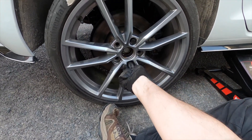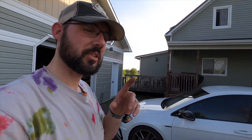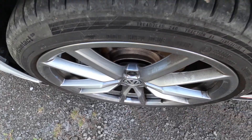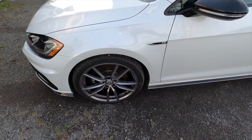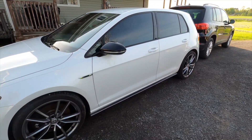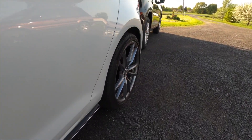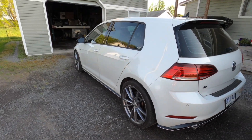The fronts are done. I tend to hold the wheel on with my foot while I get one bolt started, and then let go once it's holding. Things are looking good — I've got the wheels and tires on. I'm torquing the wheel bolts because I'm running brand new wheel bolts with the new spacers. I've already torqued them down to 80-plus, and I'm going to go for a long drive and then torque them again, just because with new hardware and spacers I don't necessarily trust they won't back off. Take a look at the fitment — 10 mil on the front and 17.5 mil on the rear. The wheel gap will come down a bit since the car was just lifted. That looks pretty awesome.